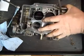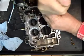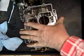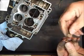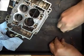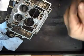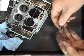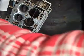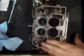I do have jets available for these. Some of the older ones sit around with water in the bottom of them, and they can sure get corroded — they are a pain to get out. I've had to drill them out. So these are the secondaries, and you see the holes are smaller. The two primaries — I got the wire in it.